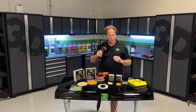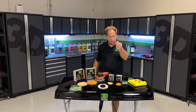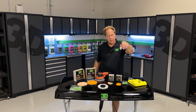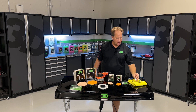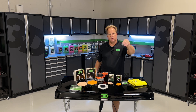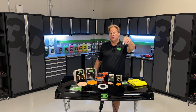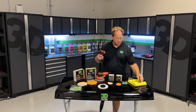When this tool launched, it came with three different drive units. It came with a rotary unit that spins the disc or the pad in a circle. It came with a three millimeter, which was for a one inch sanding disc to take out things like dirt nibs and fresh paint. And it came with a 12 millimeter free spinning drive unit, which is what most people are using with a foam or microfiber pad with the Pixie to remove swirls and scratches and do paint correction.